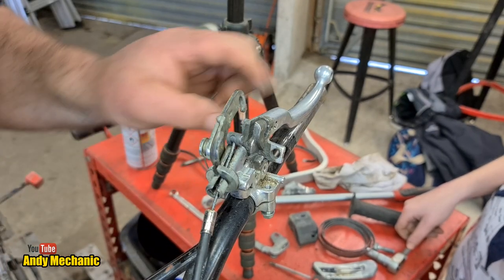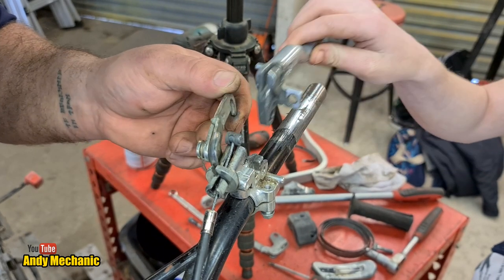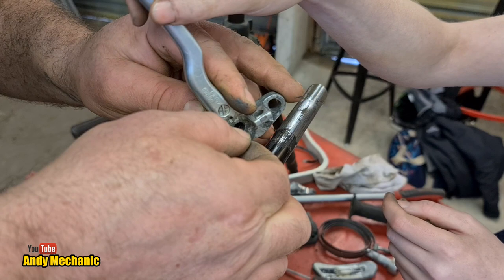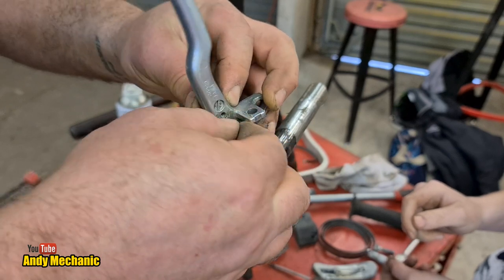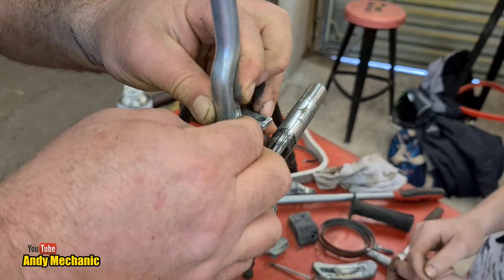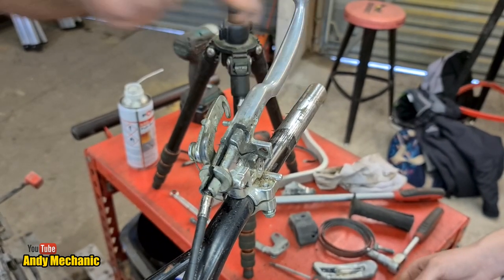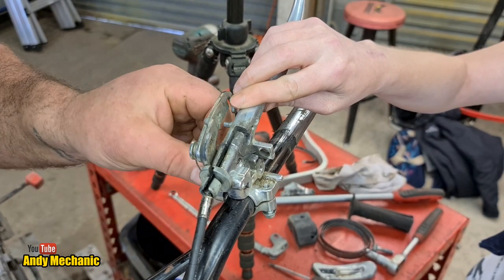Good to go on this side. Grab the lever because it's going to drop down. Pull the lever out of the joint. Now we've got to tilt it over and get the nipple into the end of the lever there. This is only temporary because we are going to fit a new lever at some point, but it's only a five-minute job now. We've changed the perch. That should now go back down into its hole. There's plenty of old grease in there so we're not even going to bother to clean it up, because I need to do all that when I swap it out.